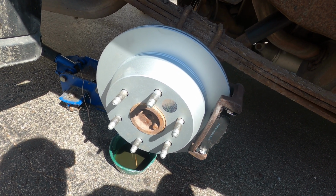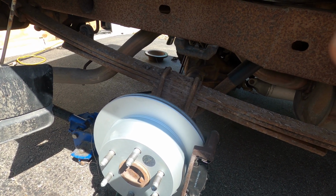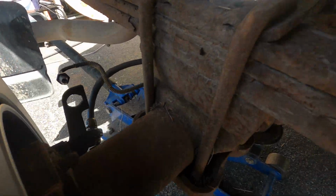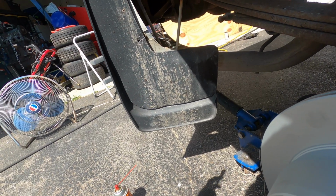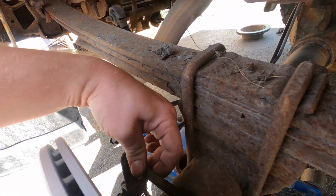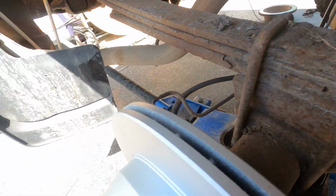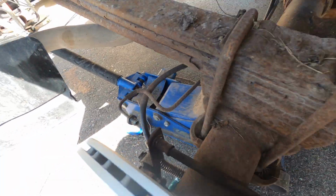So we'll get that line back on, and then I got a vacuum bleeder, so we'll try that thing out. I haven't used it yet. Okay, so when you put the line in, there's a little tab, so you can see in the hole there's like a rectangle on the right, and then there's a rectangle on this that locates it on this inside edge. So there it is. So we want it sitting this way. It'll make sure it's not twisting all funny, right? Keep us from putting it in circles, and that's what holds it in place when you tighten down that other piece. So that goes in, and then the clip will hold it on. I'll need two hands for that.